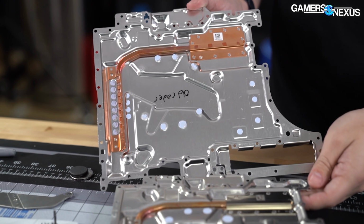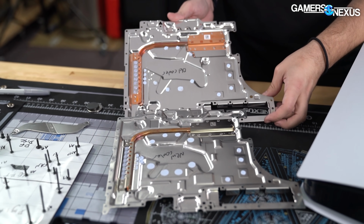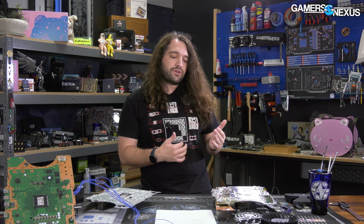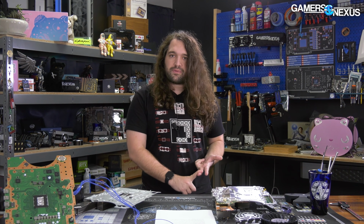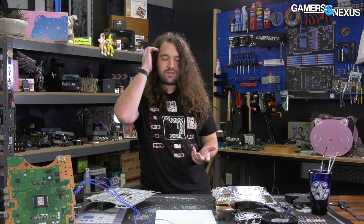Finally, a brief explainer why a smaller heatsink may or may not benefit the PlayStation 5. So in scenarios where it does potentially benefit the PS5 thermals, what you're looking at is a combination of a base plate change where there's a better contact patch with the memory in some locations now, still a concern, but better contact patch with the base plate changes. The heatsink proper potentially has less flow resistance now. This is something we could test if we needed to go further with it, but potentially less flow resistance.